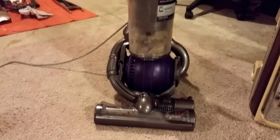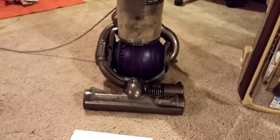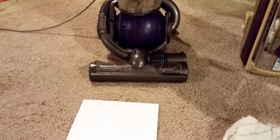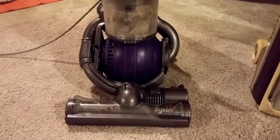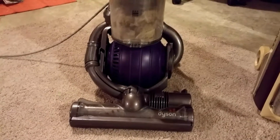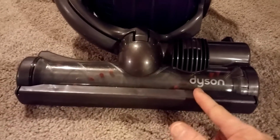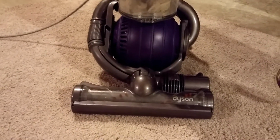Well, as you've seen in all my videos so far, suction means pretty much nothing as far as picking up dirt. We've done sand, we've done flour, both on top and underneath the carpet. We've done stuff here on my concrete floor, and suction just doesn't really matter much. But I'm sure if I measured this machine, there just wouldn't be any appreciable difference whatsoever. So maybe 1 or 2 inches of water lift. But bottom line is this thing tests out at nearly 100 inches of water lift anyway, as measured from the hose, not measured down here. Here is probably something in the 50s. It's pretty high for a machine. I mean, after all, Dyson says highest levels of suction. They'd get in trouble if it wasn't.